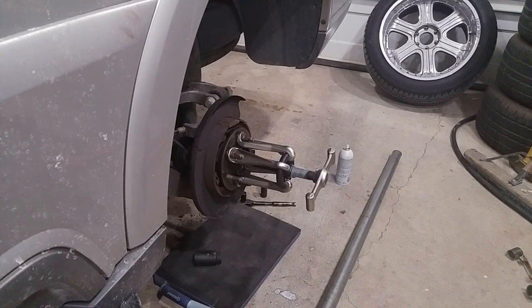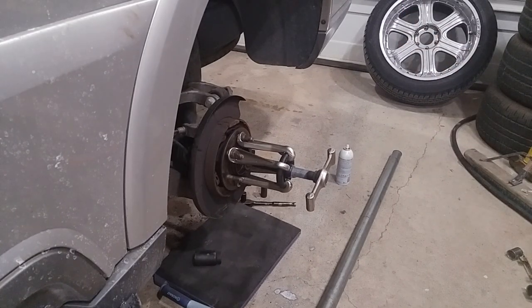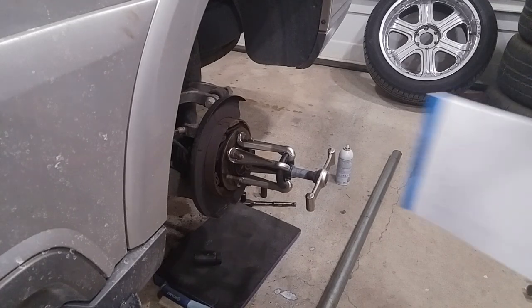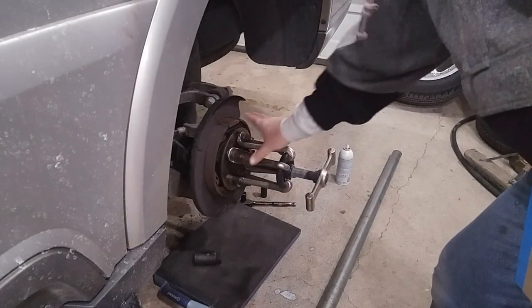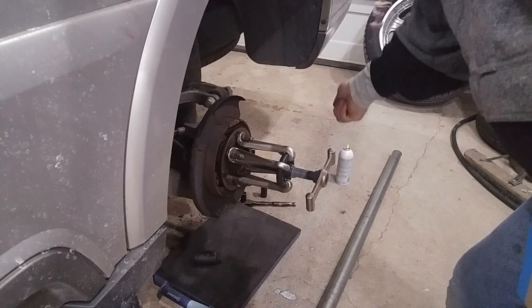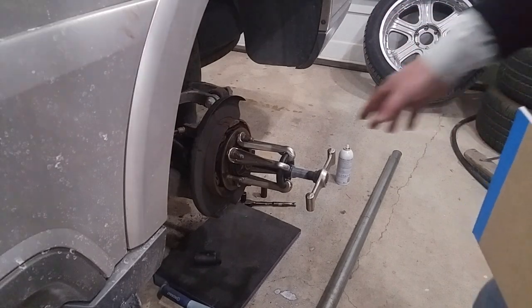So I bought the 6574 — it's going to be heavy-duty hopefully, and the thing weighs about 10 pounds assembled. I had to order an additional leg; the part number is 32937, and it's the same leg used on either the 7394 or the 6574. Both tools come with three legs, which works fine on a five-lug vehicle. But I have a six-lug vehicle, so going with only two or three legs would put me off-center when applying force.